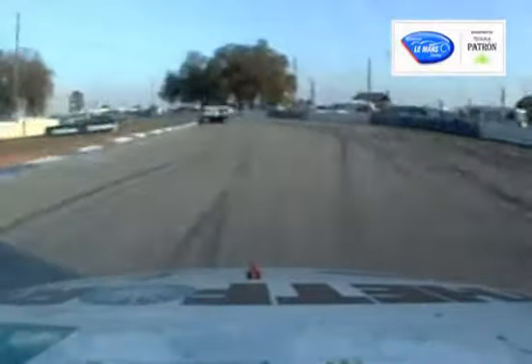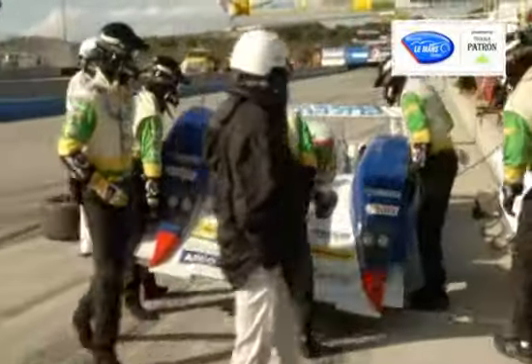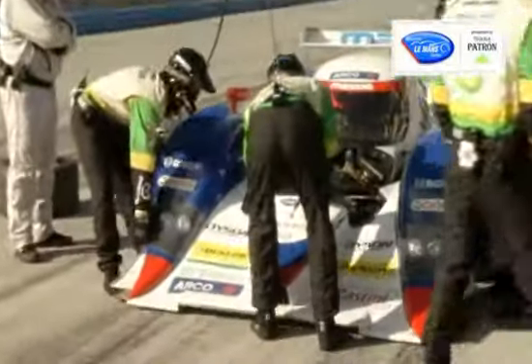If you have a car that's very height-sensitive at the front, you've got to run the front stiff. And that then creates all its own problems — you're overloading the front tyre, you don't get the tyre life out of it, and you can't get over the bumps properly. So the aerodynamic design of the car dictates hugely what you can do with the springing.